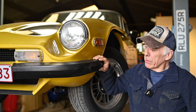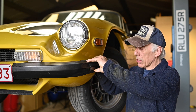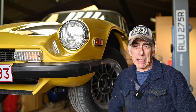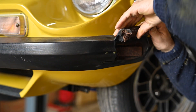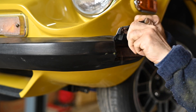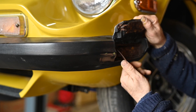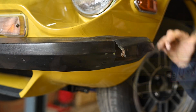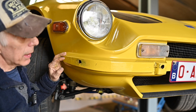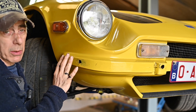It's time for the bumpers because the bumpers on the TVR are in a very bad shape. They are ripped apart and in fact the metal bar inside is so rusted that the parts fall out. I can actually pull it open and inside it's all rust. So I'll have to replace them and put some new ones up. I already removed one bumper in the front and one in the back by grinding off the nuts or bolts that were holding them — only two holes — then cleaned it up a bit.